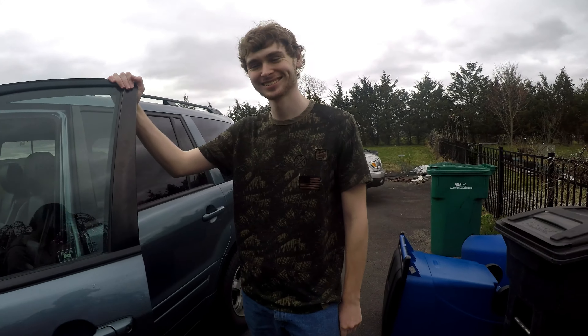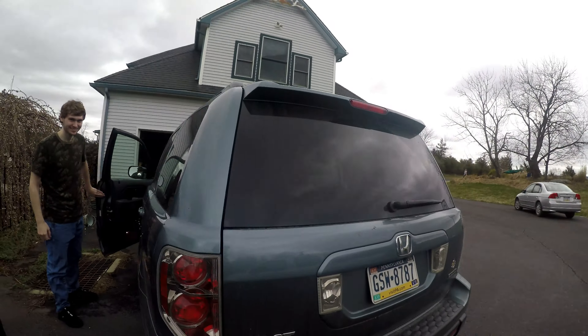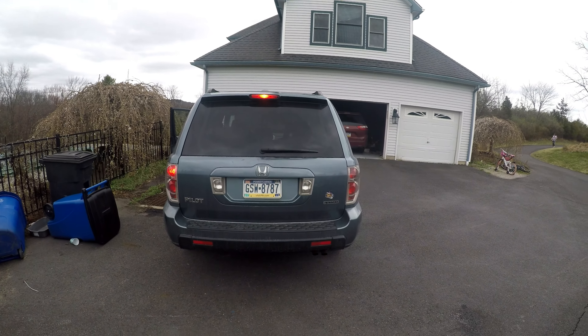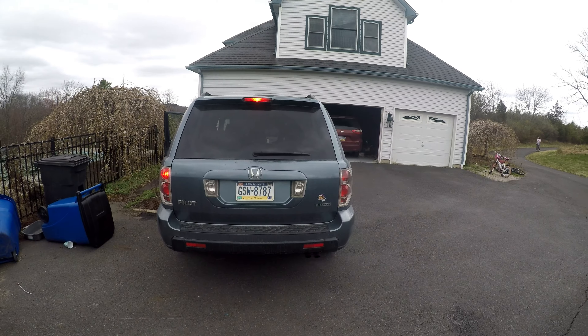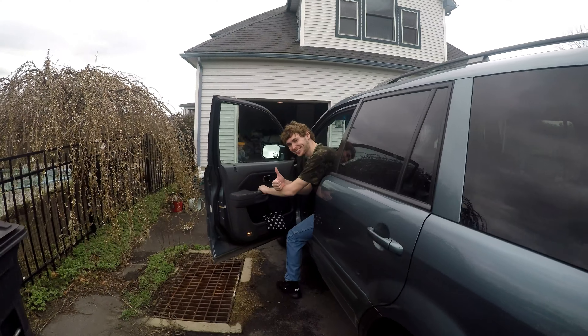We're going to play around and see what happens. I'm going to pull this bad boy out and get to work. I guess I check when you press the brake light if any of them come on. One of them's out. One of them's out? Yep. Alright, that's probably our problem there. Good work, we figured it out.